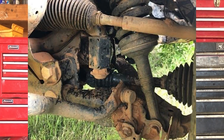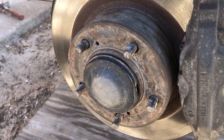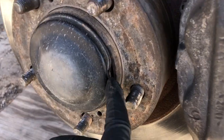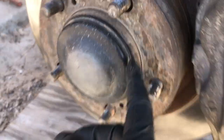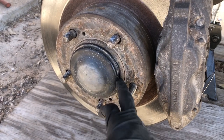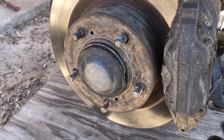If you'd like to jump to a specific section, click the time link in the description. Before we start, I'd like to recommend an inexpensive part to have as a backup — this wheel cap that covers the 39-millimeter nut to access the CV axles. If the people working on your truck aren't careful, they're likely to damage the cap. A damaged cap can no longer protect against dirt or moisture getting into this chamber, which can cause it to seize and become very hard to remove. I'll put the Toyota part number in the description.